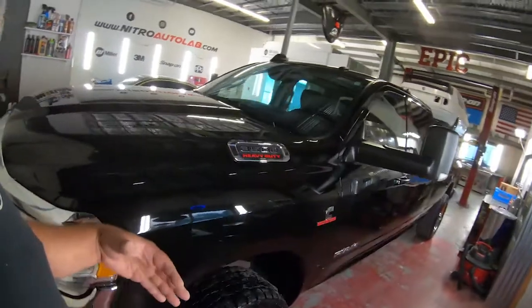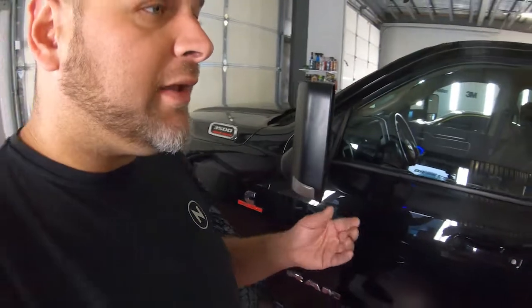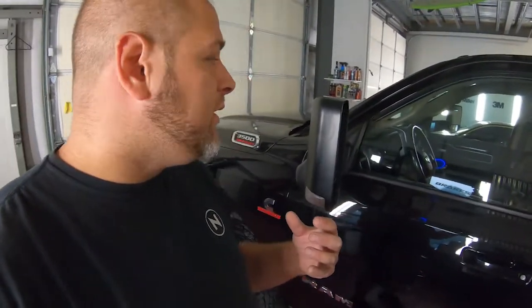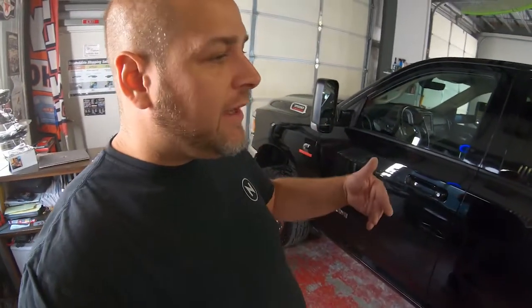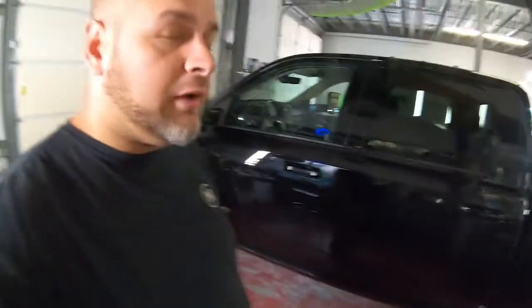When installing these coatings you will get spots you need to pull out in natural light to see areas you might have missed. If you miss them they are very hard to remove because as the coating hardens — and you're supposed to let it harden overnight before delivery — it becomes basically a permanent coating on your vehicle. When you pull it out in natural light you may notice a couple spots where you didn't wipe it in fully. It's very important to get a good look at it before it fully cures so you can go back and wipe those spots in. If not, you have to polish them off and start over from scratch. Be very careful and follow the instructions thoroughly.